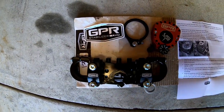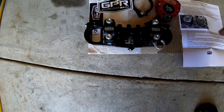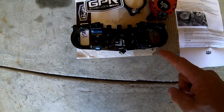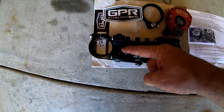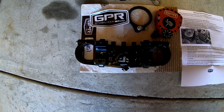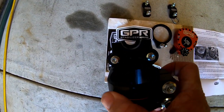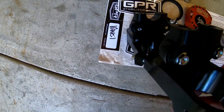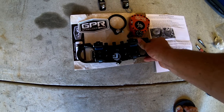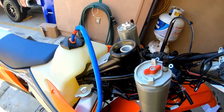Here's the part where I normally read the instructions after I've taken everything apart. I'm going to read them and figure out how to put on the bottom bracket. I've already dismounted the top brackets so they're ready. I'm moving the adjustable handlebar mounts all the way forward because I'm a bigger guy and I like more room between my handlebars, seat, and foot pegs. I'll probably use blue removable Loctite so nothing vibrates loose. These are the rubber-mounted handlebars — they just came out with this — and the slight rubber gives the handlebars more pliability, which is good for keeping your hands relaxed on long six or eight hour rides.